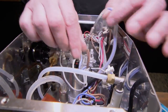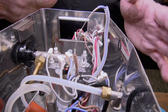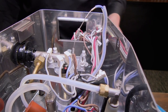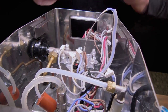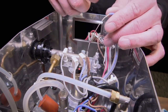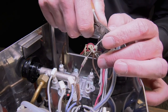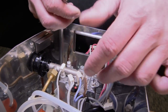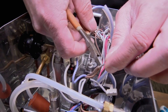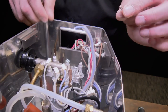Now I'm going to slide this tube off — it can sometimes be stuck, so you just need to work with it a little bit. Once you get it going it will slide off. Sometimes if you straighten out the wire on this end it'll slide a little bit easier. That's why I cut all these zip ties — so it has room to move. If you didn't cut them, it wouldn't go anywhere and you'd be fighting with it constantly. That makes it easier to get to the wires that the fuse is hooked to. Now we have the tubing out of the way and you can see the fuse is out in the open.